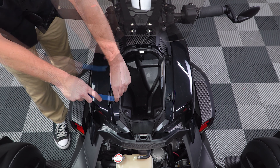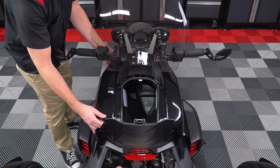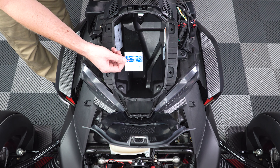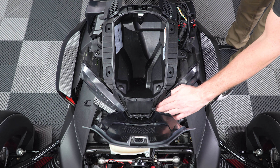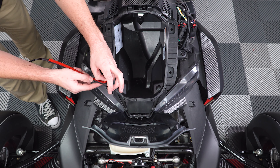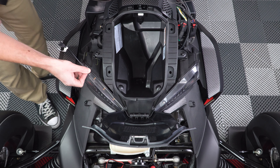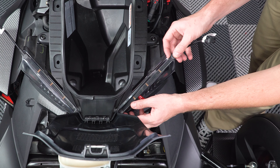Open your glove box and pop out these four pushpins, then slide open your fuel door and pop out these other four pushpins so you can remove the two side panels. Take an alcohol prep pad and clean the surface area on top of your headlight lens. Let that dry for a minute, then coat the same surface area with the primer wipe. Once dry, take one of the short LED strips with the inverted LEDs underneath the adhesive strip, peel off the protective backing tape, line it up with the lens, and press down firmly to adhere it in place. Repeat for the other side.